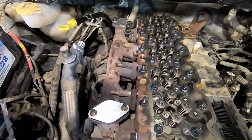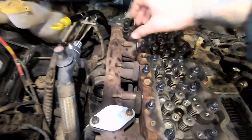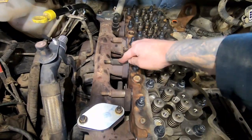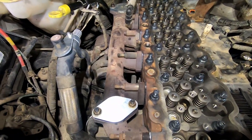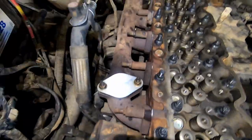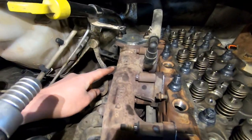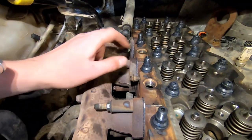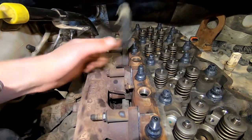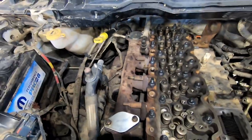With all the gaskets and studs in place, tighten them all up to 32 foot-pounds. Start at the middle and work your way out. The exhaust manifold is all torqued down. I got the coolant line that runs underneath it bolted up — there's a bracket up top and one on the back stud. Going to put the two coolant fittings in, get the cab heater hose on, and put the dipstick bracket back on to finish everything on the passenger side.